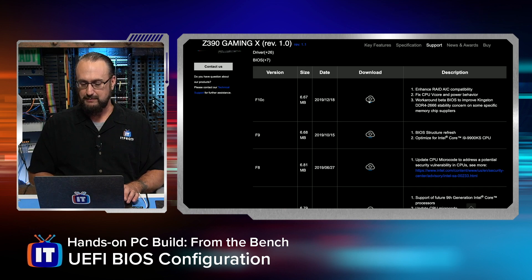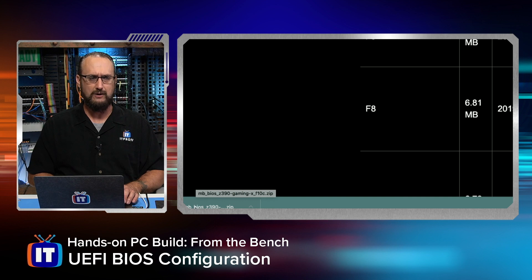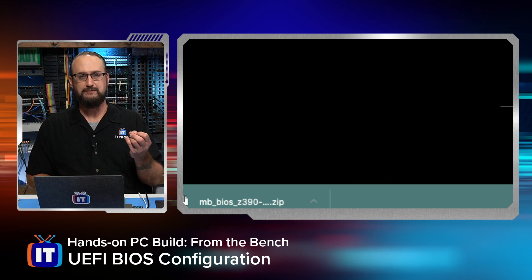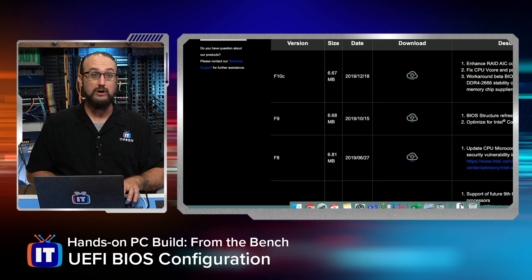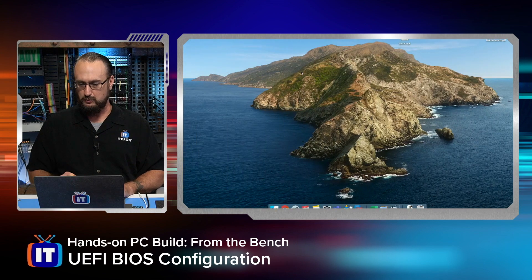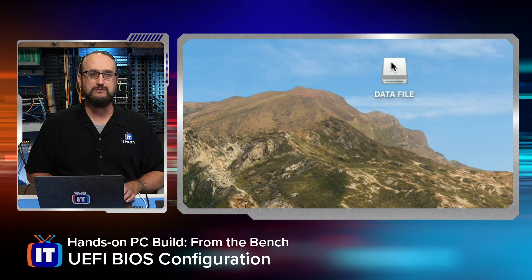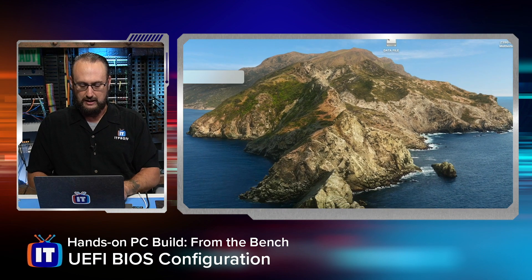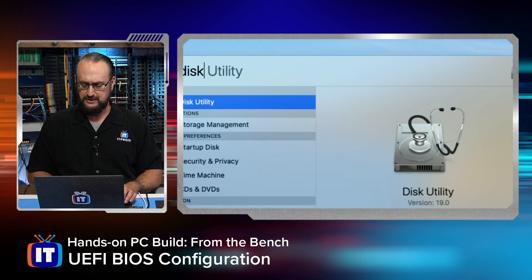So I'm going to download this — you'll see it's a little zipped file down in the lower portion of my screen. I've got a USB thumb drive installed on my Mac, and we're going to format that USB thumb drive. We're going to unzip the file, bring it over to the thumb drive, then plug that into our PC and update or flash the BIOS. I'm going to close out of my web browser. You'll notice I've got this USB thumb drive plugged in — it says 'data file' — and I need to format it in a file system that this PC is going to recognize. Typically, you're going to want to do this in FAT32. So I'm going to launch up Disk Utility.